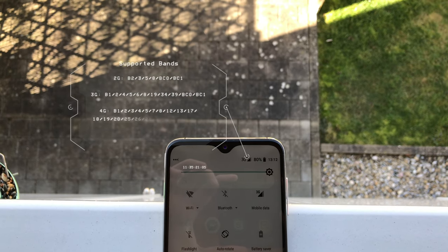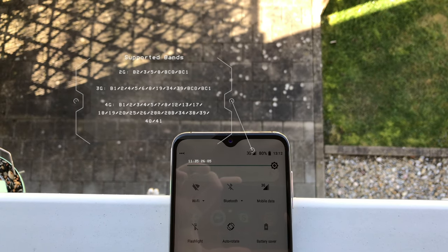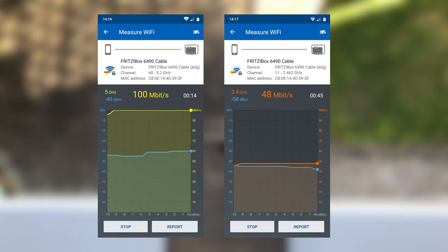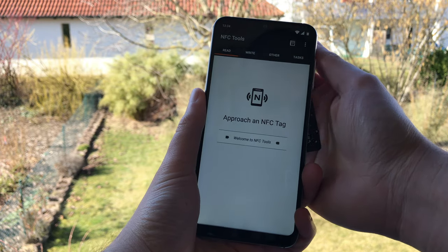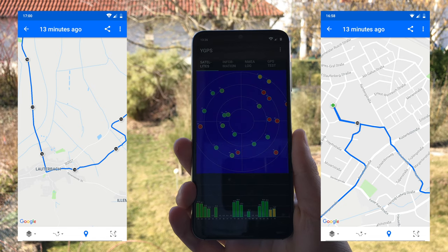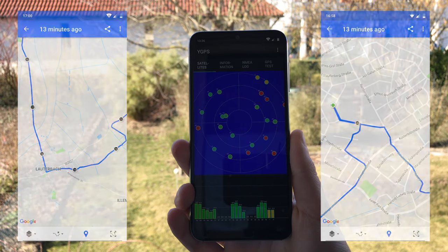Cellular reception quality is very decent with no issues even in areas with weak coverage, and the phone boasts global frequency coverage, which is a big plus when travelling. The dual-band WiFi a/b/g/n module offers a maximum throughput of 100 Mbit/s with decent reception; one floor below the router it scored a stable 40 Mbit/s. Next to Bluetooth 4.2 with decent range, the One Max also supports NFC, which is nice to see at this price point. GPS reception quality is excellent and accuracy is very good — extensive navigation and tracking tests confirmed this with no exceptions.